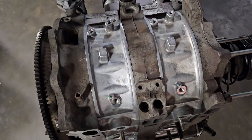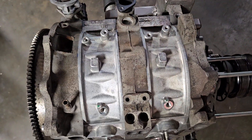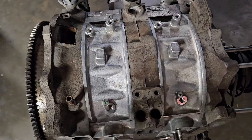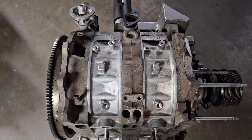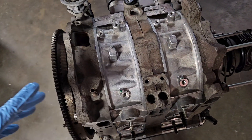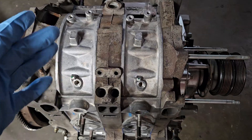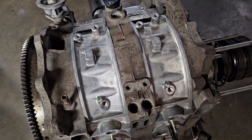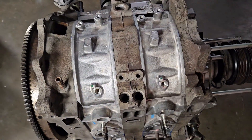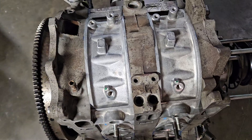In the application of trying to protect the investment and get a little bit more reliability in the performance area of what this motor is going to do, we did upgrade the apex seals to a 2mm two-piece ENJ. It's one of my favorite seals. There are some other great seals out there that also have the bendable or non-breakable quality, and that's something that can be really desired when you're up against a situation where detonation may happen again and you don't want to damage your other components. Obviously there are always trade-offs — when you go to performance seals, they might not last as long as an OEM seal, but most of our performance builds are never going to go 100,000 miles. We're just trying to enjoy them, protect our investment, and get them to last as long as we own the car.